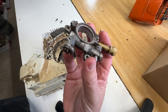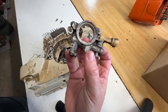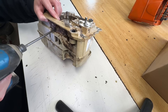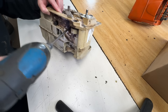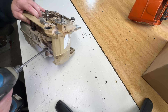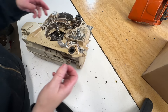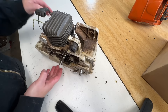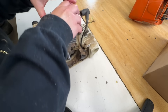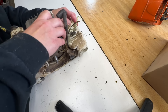Actually, I'll keep every part of the saw just in a parts box, labeled what it is — just like Donnie Boy does in his shed. And then as you need parts, you just go back and see if you have them. Let's take the four cylinder bolts out. Those four bolts are loosened. Now we'll wrassle this engine out of here. I don't take 290s apart this far every day, so just bear with me.